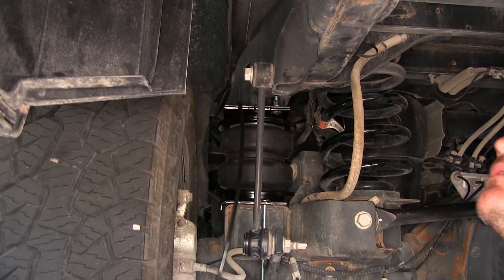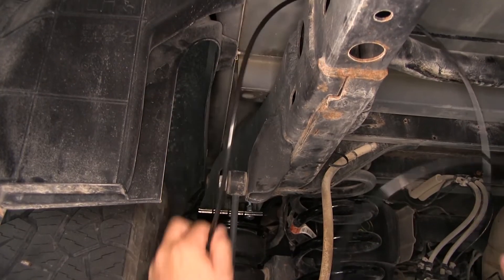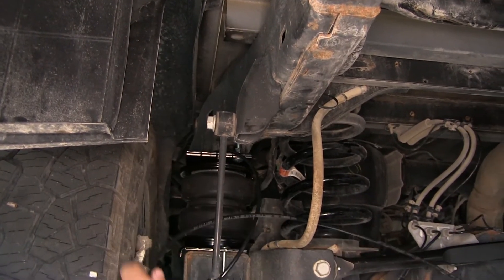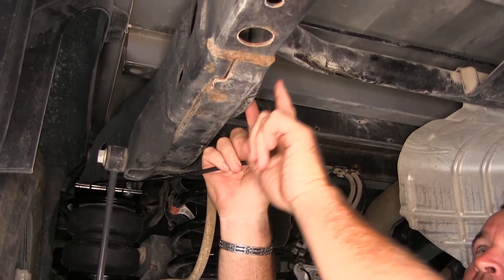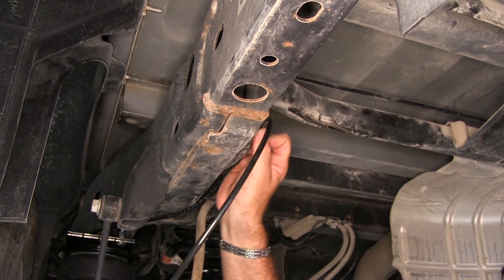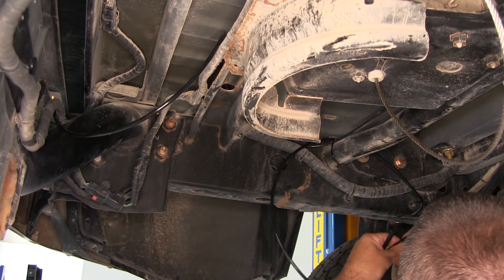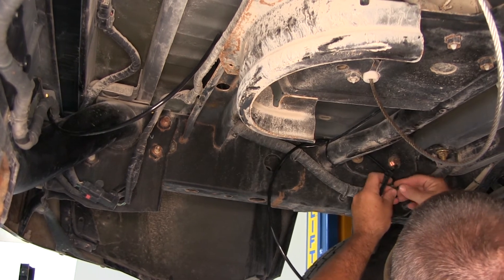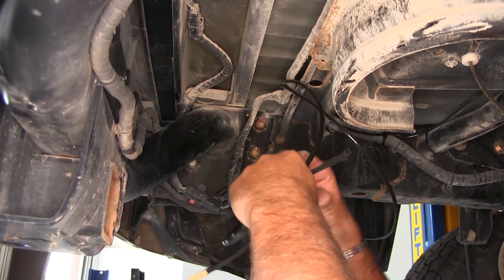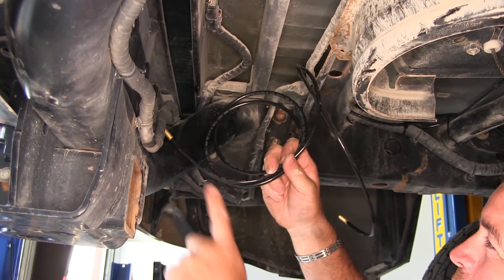Route the line up and out of the way — on the driver's side, you can go up over the top of the frame rail or come underneath. On the passenger side, you can't go underneath because the exhaust is there; you'll have to go over the top. Route it right to the back bumper of the vehicle and zip tie it to the existing wiring. Keep in mind the spare tire goes up here, so don't run the line underneath — go over the braces where the spare tire will go. Bundle up any extra line since this end needs to go outside on the vehicle.